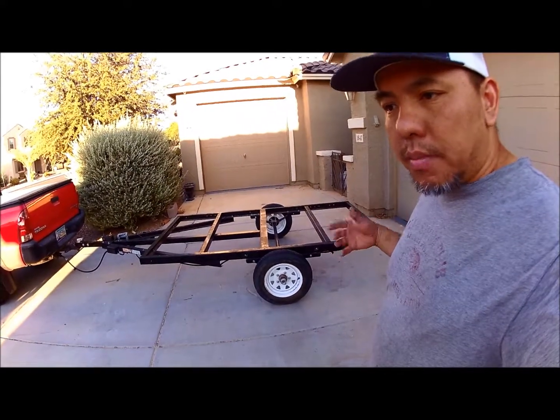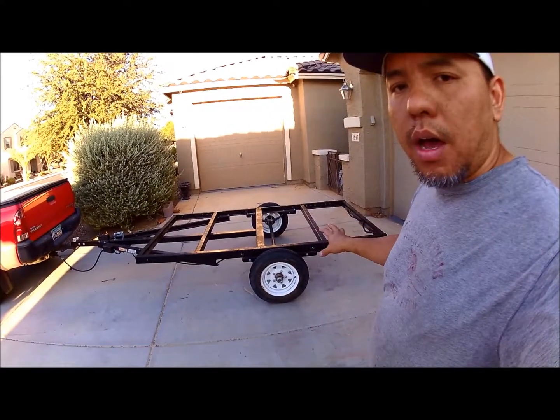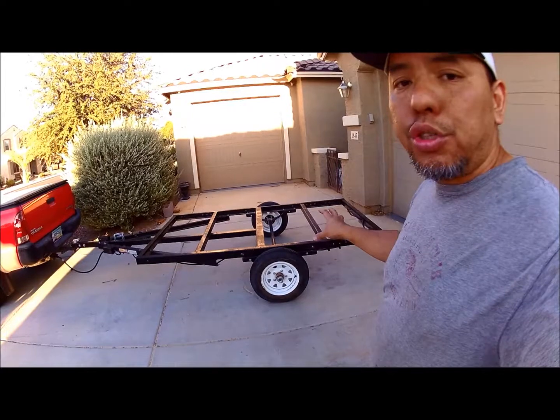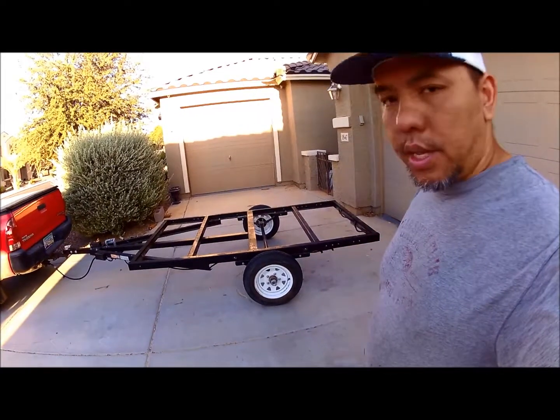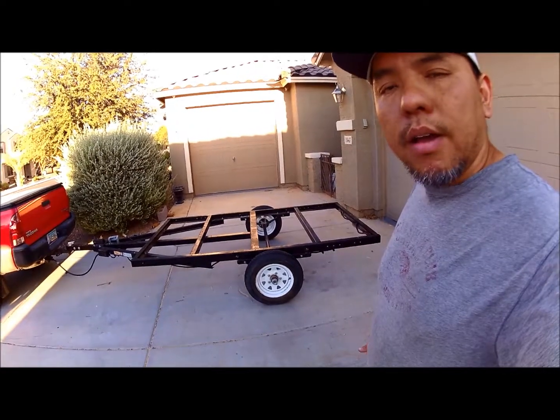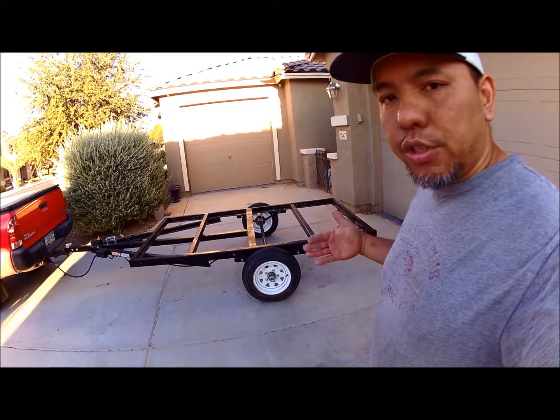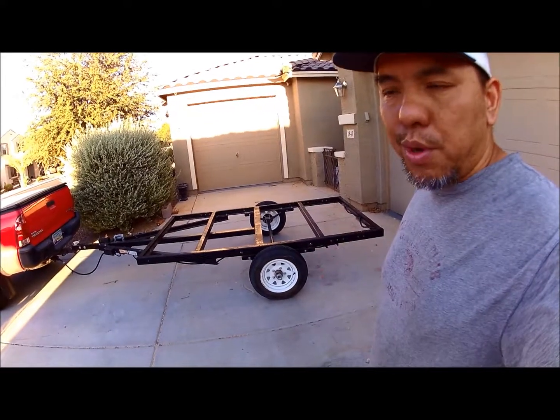if you decide to upgrade your wheels later, you're going to have a lot wider variety to choose from that will fit on these. As a matter of fact, you can technically put Jeep wheels on it because the older Jeep wheels are 5 times 4.5 spacing, and they will fit. You just need a spacer to push them out, which is like 30-40 bucks.